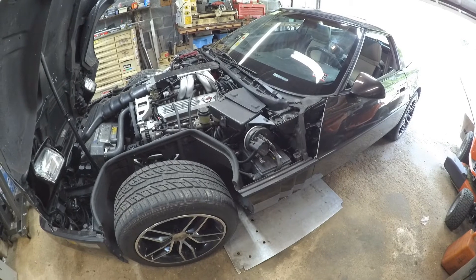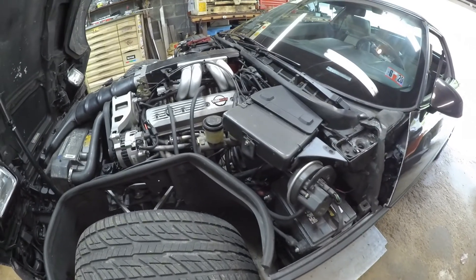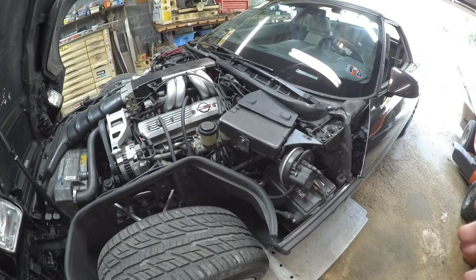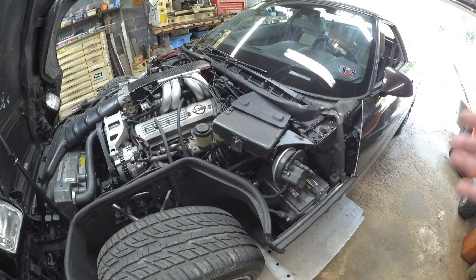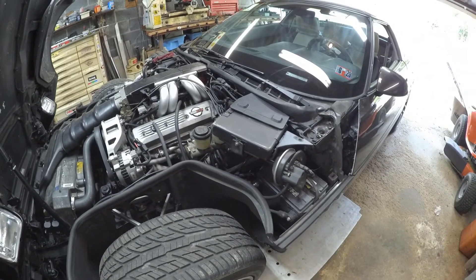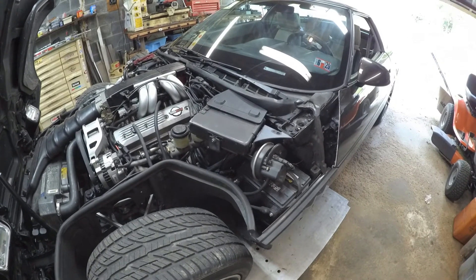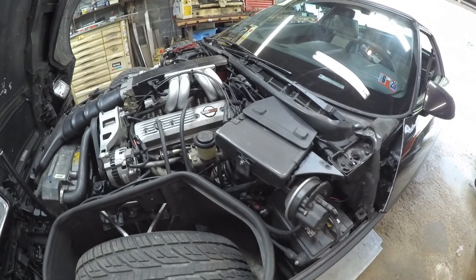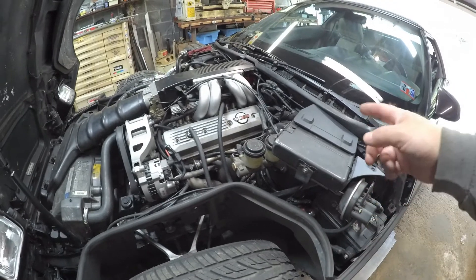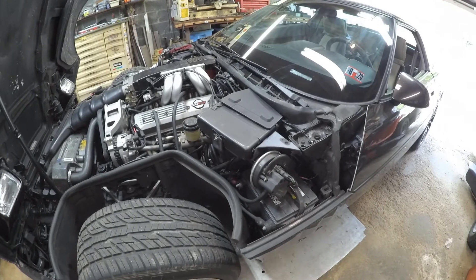I am out in the garage and I'm going to hook up the emulator — the Ostrich 2. Depending on your car, of course, the adapter you need will vary. Everything varies depending on your application — if you've got a Ford, you'll need a different adapter and your ECM will be located differently. No matter what your application — Honda, Ford, Chevy, whatever make the emulator can be used with — you're going to want to disconnect your power before you remove your chip and hook up your emulator. That pretty much should be standard with all ECMs that I'm aware of.